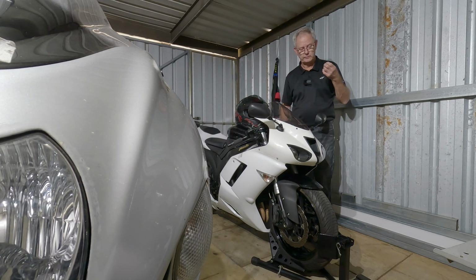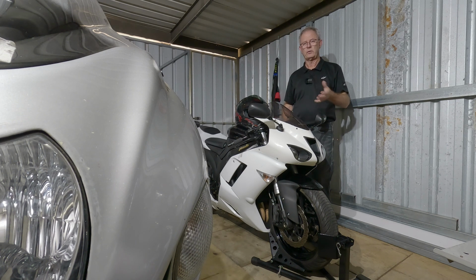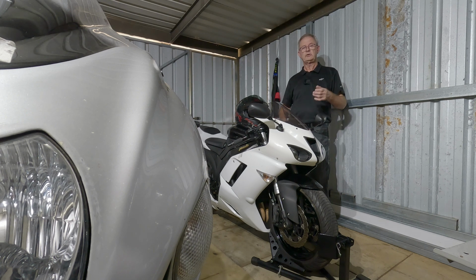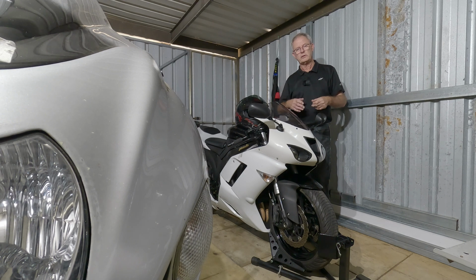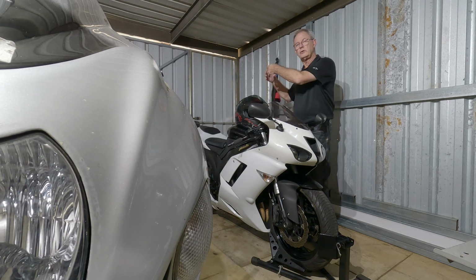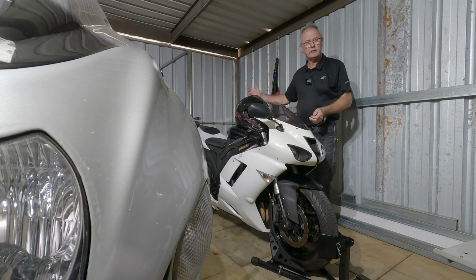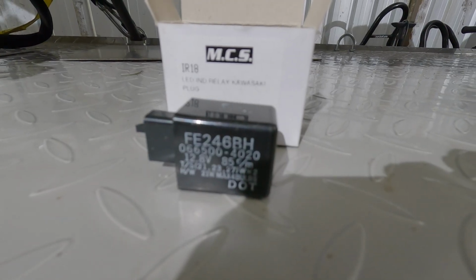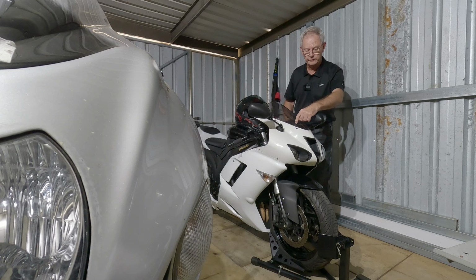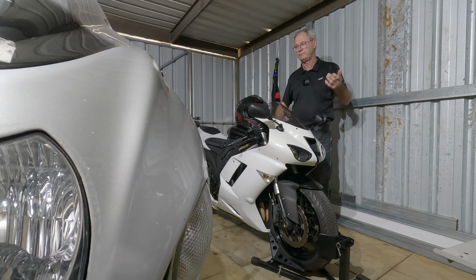And the other thing is to make sure you get your brake service, new fluid, and bleed the brakes. Otherwise the brakes aren't going to work at the end. It was just my bad luck that the rear indicators, the rubber boots, just fell apart. And I forgot to mention, I had no indicators. Once I put the new indicators on at the back, and they're only standard bulbs, the indicator flashing wouldn't work. The actual flasher unit died, which lives under the front up here, so I had to go and buy a new flasher unit. Just my bad luck.